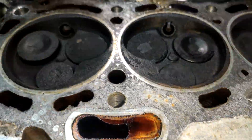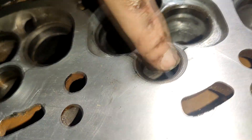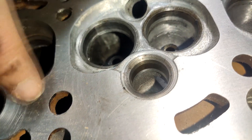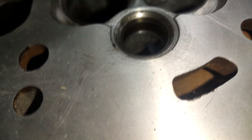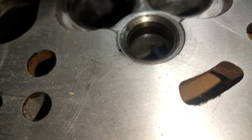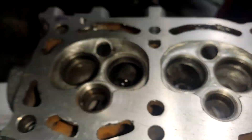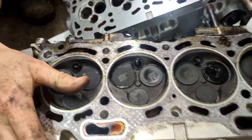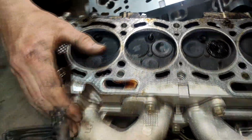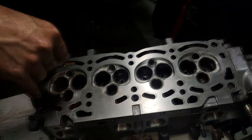As you can see, no problems to the cam. If we come over to here - this is a 2E engine, you see it's flush. Originally I did want to shave all this back like a 3E head, but I was told I couldn't do it because the water jackets in here were too close to do it, so that was a different casting. So what we're going to do is still put the 2E head in and get all that going in my car. But in the background I'll be getting my 3E built and ready to go. I'll upgrade all this stuff and put new valve springs in this - I've still got to whip this together but it's all looking good, this head.